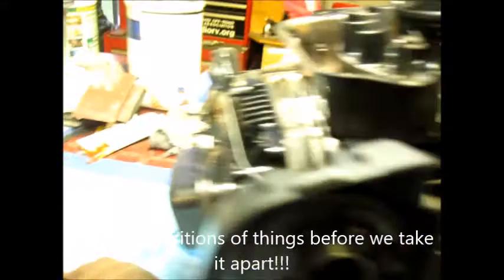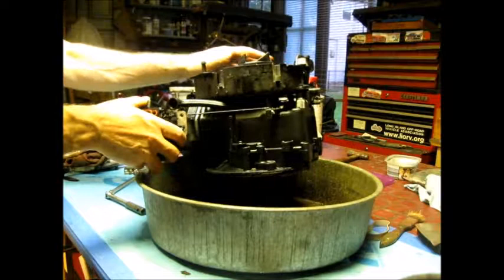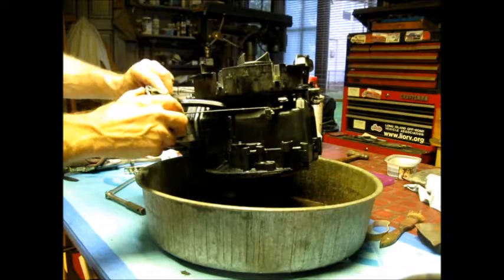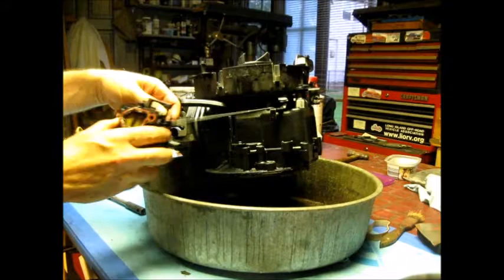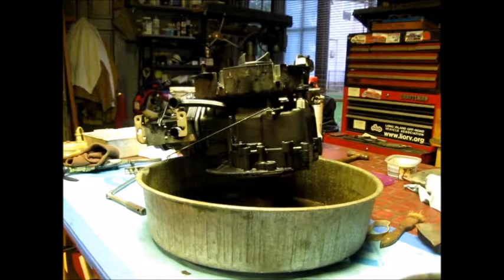There's a spring on the bottom, rod on the top, and notice the thermostat up here — does it seem like it's bent? That controls the choke. This should come right off, which it does. I had rebuilt this carb and managed to get this thing together. It had some issues — the guy lost the spring, and that was the one with the four penny nail doing its job in there.